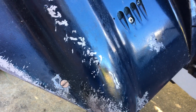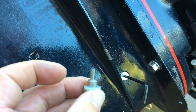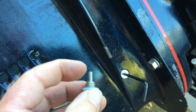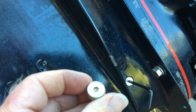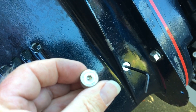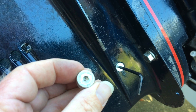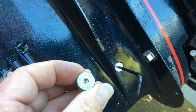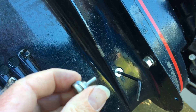This is an example of the plugs I'm replacing the engine with — using a little allen wrench hex plug instead of the conventional slotted screw. This will make draining the lower unit much easier in the future.